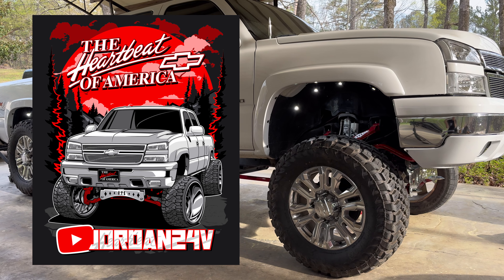I'm going to hook these up to this DeWalt battery real quick, just to show y'all how bright they are and how good they look. This is a 20 volt battery, so if you're doing this at home, do not leave it on there long term. These are meant to work on 12 volt applications, but just for right now, a couple of minutes on here, it won't hurt it. The B plus right here is for your positive, the B minus is for your negative. Here they are hooked up.